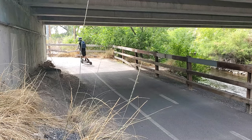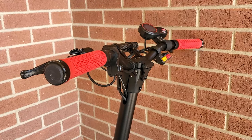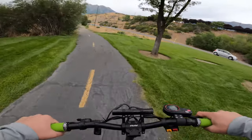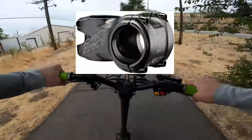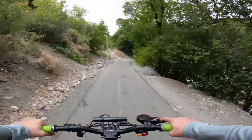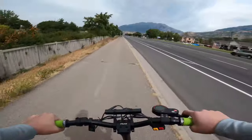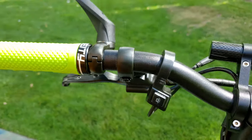Overall, the look and design of this scooter frame is one of its strongest features. My biggest issue with the design is the strange choice for mounting the handlebars. This handlebar clamp makes replacing the handlebars really difficult, as you are forced into finding 22.2-millimeter handlebars to fit the clamp without gaps. 22.2-millimeter handlebars are really uncommon now and difficult to find in wider sizes. The extra-large stem base also makes replacing the clamp impossible. I was also somewhat disappointed in the stock handlebar grips — they're foam, feel a little cheap, and rotate around the handlebars quite easily. I replaced these a while ago.